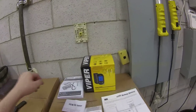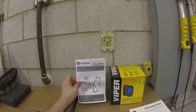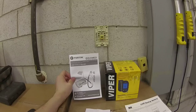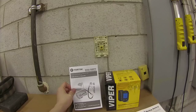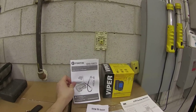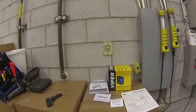This 2014 Wrangler did need an interface module, so we used the 410 EVO-CHRT5. This makes your life as an installer much easier because it's a T-harness plug-and-play system. Now I did hardwire the 410 module to the Viper. The D2D and RS-232 protocols are not always as reliable as we would like between the Viper and 410, so hardwiring guarantees a secure connection as well as proper data-to-data feeds between the two modules.